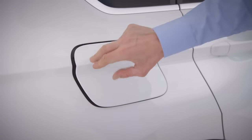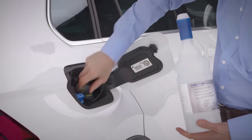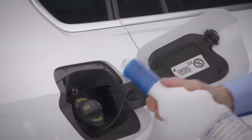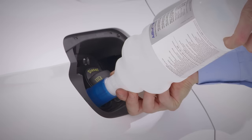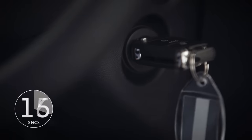When you need to refuel your Tiguan, simply press the tank flap inwards, unscrew the cap and place it here. If you've got a diesel with an SCR, you'll need to refill your AdBlue between 3,000 and 4,000 miles. You'll get plenty of warnings on your instrument cluster — the first at a range of 1,500 miles, repeating every 62 miles until the range reaches 1,000 miles, at which point the warning turns amber. If you allow it to go red, you won't be able to restart until the AdBlue level is refilled. Always fill it to the top, and switch on your ignition for 30 seconds to allow the system to reset.